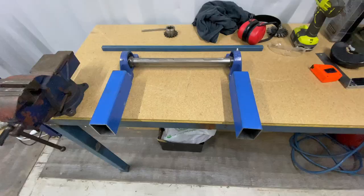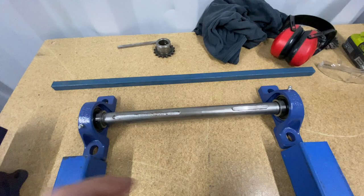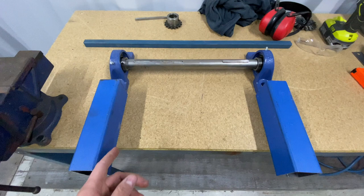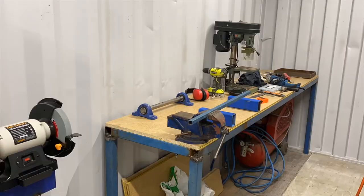I'm going to make up some new mounts for that and then we'll jump onto that clutch. I've got the pillow blocks here laid out. I'm measuring the distance between them — I'll set them that same distance apart and cut this little bit of steel, weld that in just temporarily to hold it nice and square. Then we can sit in the swing arm, because the swing arm is actually rounded, so the bench will be nice and even and we can tack it all in.